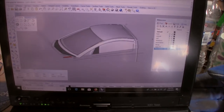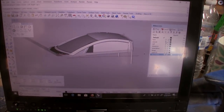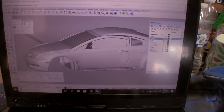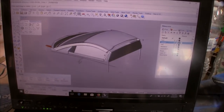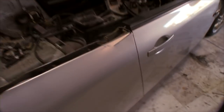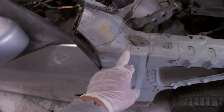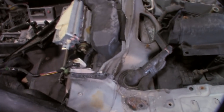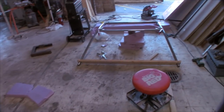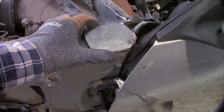I'm going to put in the new roof. The new roof is a lot lower with a more aggressive look — if I turn on the original roof you can see the big difference. I'm going to cover these areas with probably eighth-inch sheet welded in, and then this A-pillar where it connects to the front fender, I'm gonna cut it straight and cover that again, then use those as a base to weld in the roll cage.